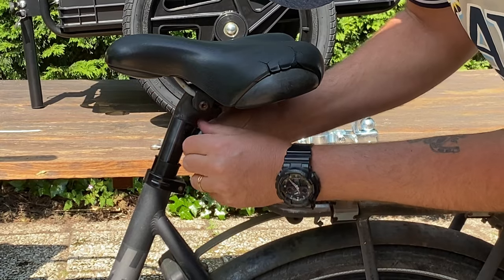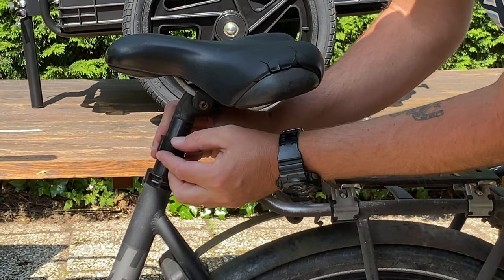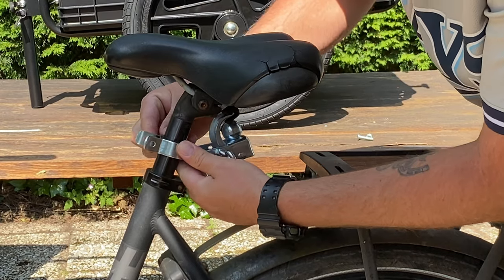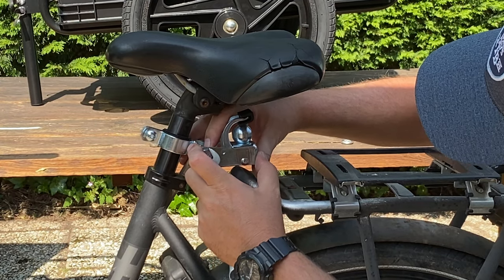Now for the hook that is mounted on the bike. First you need to place the spacers that you need depending on the size of your seat bar. Then you push the hook over the bar with the spacers and tighten everything up. It's important to put the actual mounting hook in a good horizontal position before tightening everything.